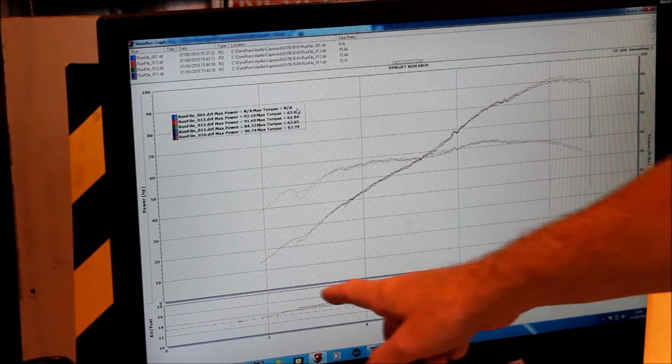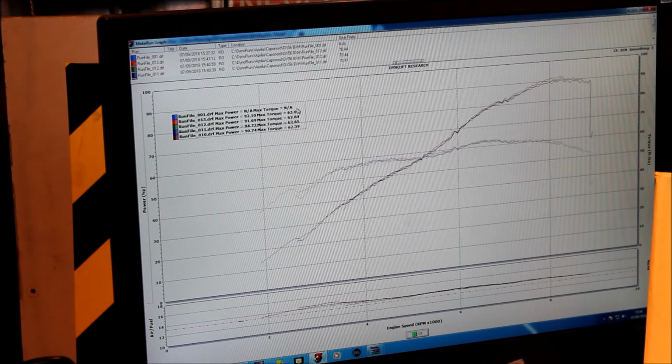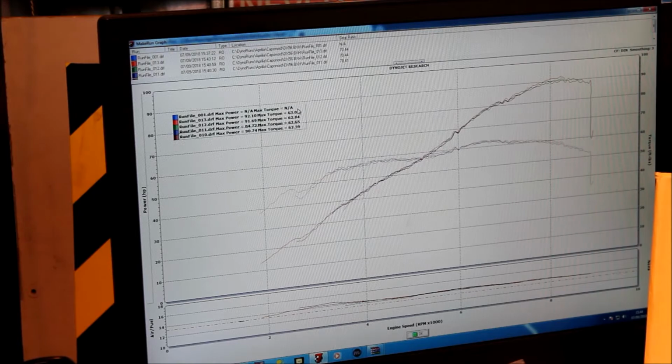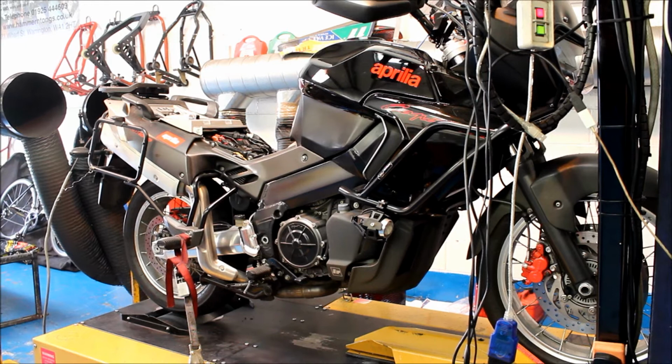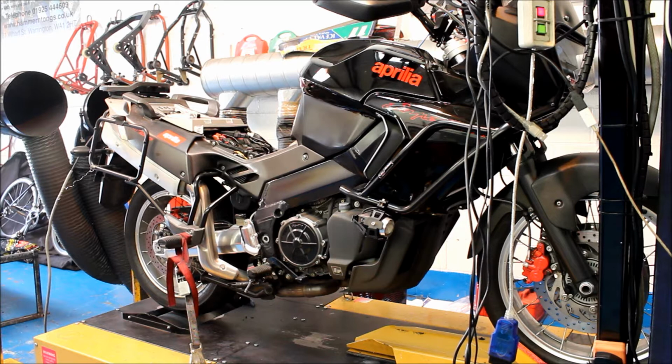Yeah, the bike dips, and in terms of ignoring the carbon, the bike's healthy in terms of its temperature, it's maintained everything alright, but yeah, blew a lot of smoke at first. Firstly, I'll go through and get a load of data off what the fuel is doing. Every different throttle position, every different engine load, try and work out from the start why it's furred itself up, why it's got so much carbon in the exhaust.